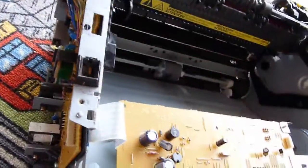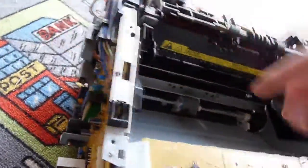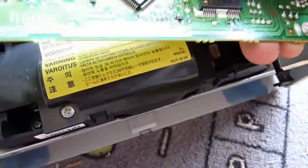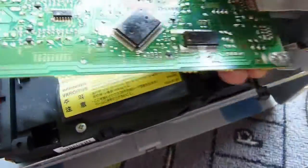You don't see much in the way of interfacing on that board. Well, a lot of it goes through here, and there will also be data communication lines for the power supply, because a lot of optocouplers communicate over here. This is essentially like an IO board which also has the motor driver chips and an auxiliary processor.